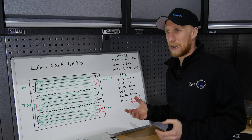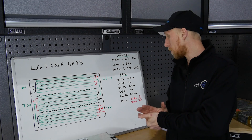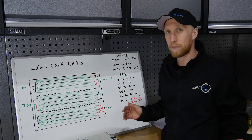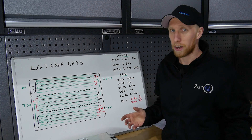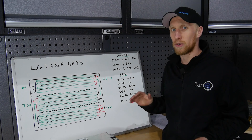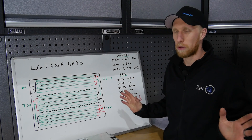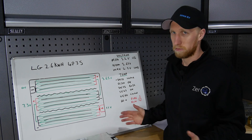From 45 to 60 degrees, usage should be limited — do lower charging rates and put less power out at that point. Sixty degrees equals fire — well, not actually, I just like to scare people. But at 60 degrees you start getting into the risk of thermal runaway. Above 60 degrees there is a real chance of thermal runaway, and yes, thermal runaway does equal fire. That's why you have a battery management system and why we do liquid cooling on all our battery packs — to always maintain temperature well below 60 degrees. Just don't go over 60 degrees on lithium-ion batteries, no matter what. Stay safe.